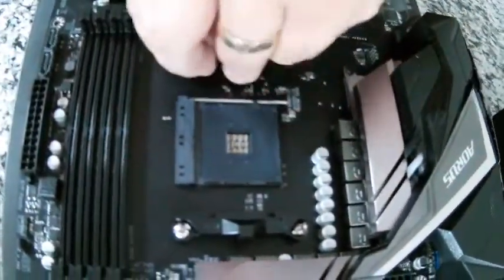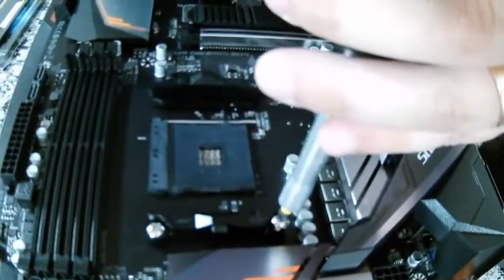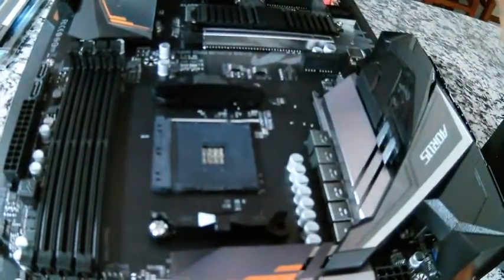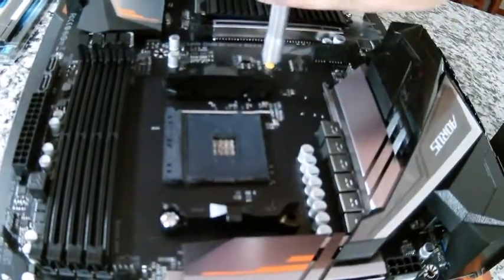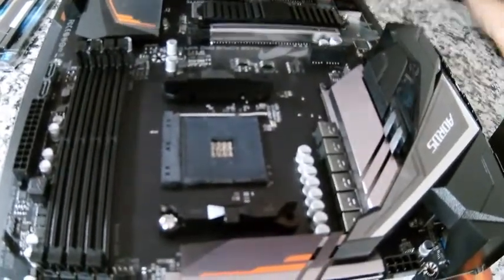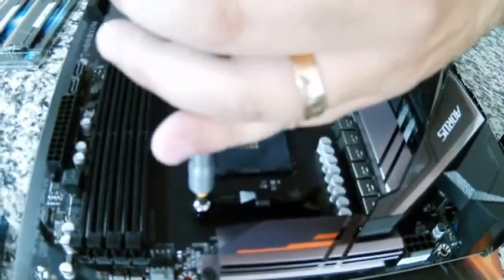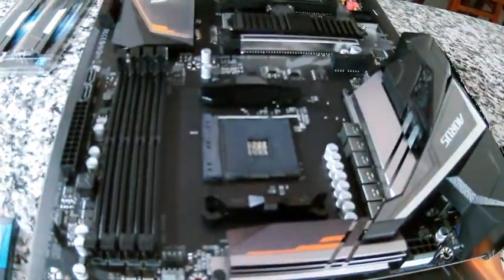And always, always, when you're doing everything, screwing, always cross unscrew everything and screw in, especially on a PC part. You never want to apply too much pressure on one side. But we won't need these brackets because we're doing stock cooler. If you had any other brackets or any other cooler, sometimes you keep them in there. Good idea to always save them for later. Yeah, if needed. Okay. These are gone, and they just simply, voila.